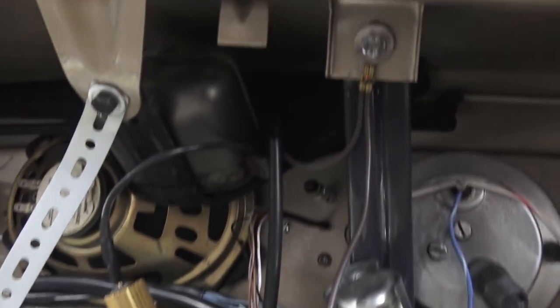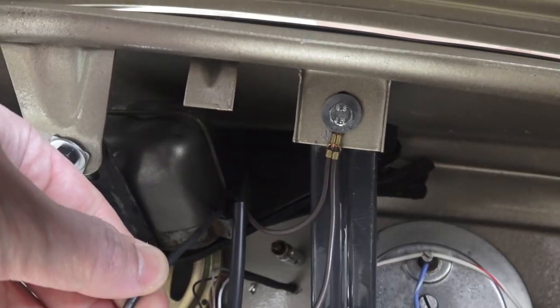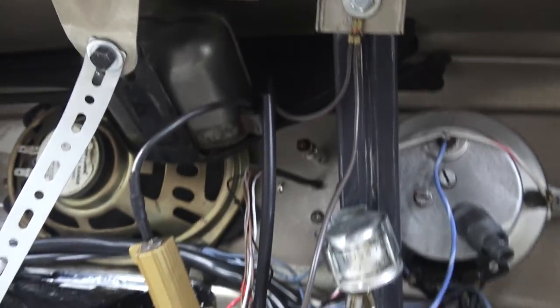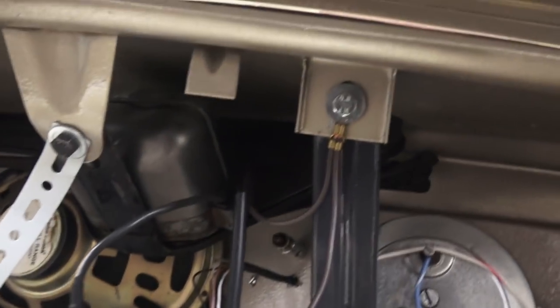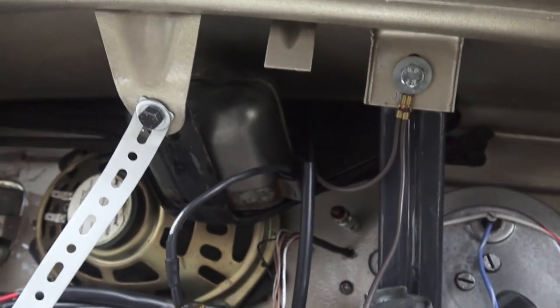What's very common is the wiper motor. A lot of times the power wire to your wiper and the black and purple wire — which is the switch wire coming from your wiper switch on the dash — are reversed. Sometimes if you swap those around, that usually gets rid of the problem. I've had that issue before.